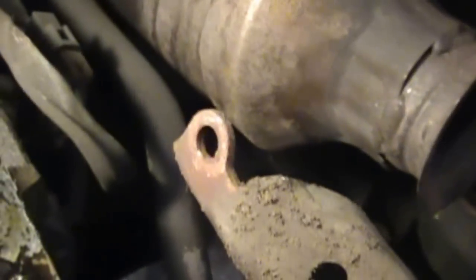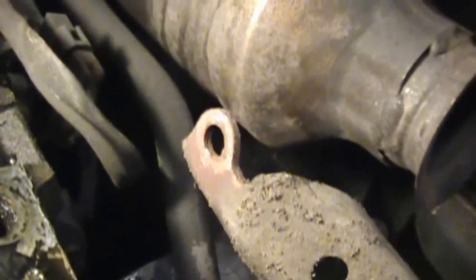Make sure you take your bolts out of the thermostat housing - kind of weird, they have a little tiny bolt right there on the back of the head. Make sure you take that out. Also there's a bracket with little tiny bolts on the bottom of the manifold on this head - you have to take that bolt out. After I got the plenum off, the intake was pretty easy to take out. I spent about two days on this with no hurry, but we'll get it done.